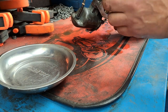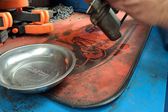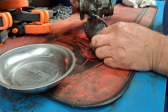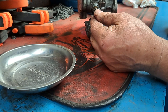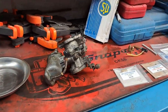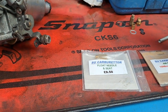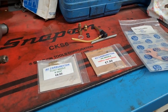There doesn't seem to be too much play on that, but I've got all the kit so we may as well. That looks well worn there. What's happening is when you pull the choke mechanism the tube comes out the bottom, but when you push the choke back in it's sometimes sticking and only going in halfway - so she's running really rich. As regards replacement parts: we've got an SU gasket kit, a new needle, a new float needle and seat, a new emulsifying tube, some clips, and a new spring for the bottom.